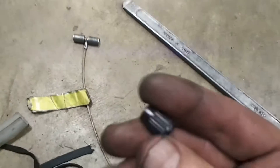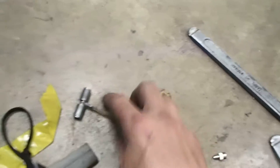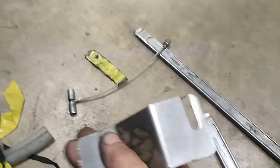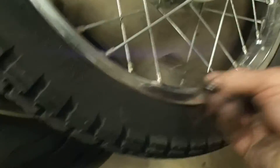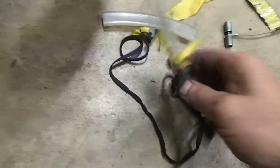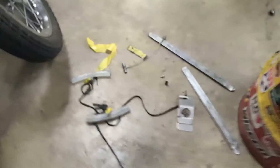This is a tire valve remover — the metal ones are the best. These come usually with tubes; they're only good for a couple of times. But this is the winner — this is the one I give as gifts. It's used to pull Schrader valves like in car tires, super tough. One side lets out air, the other side takes out the air valve. This is also indispensable: it's a third hand from Motion Pro, hooks on and holds the tube down. And these are rim protectors — I added string so I don't lose them. They wrap on so you don't scratch your rims when you take bites with the tire irons.